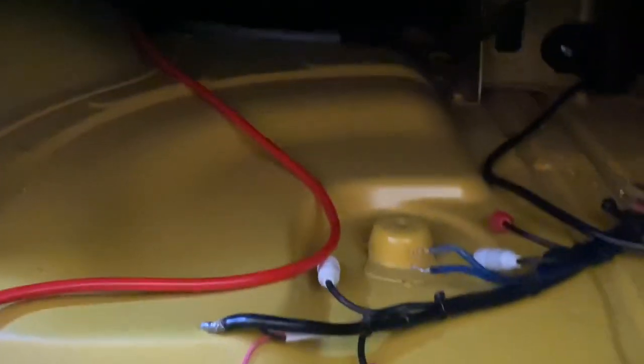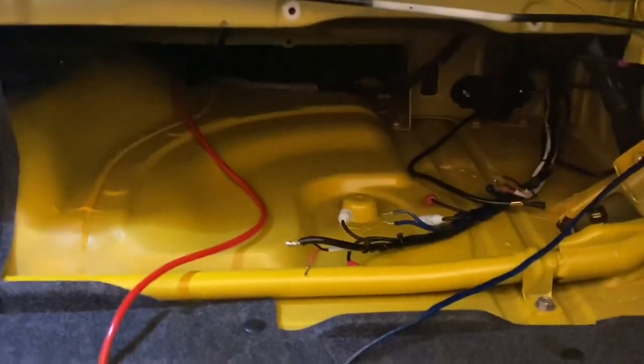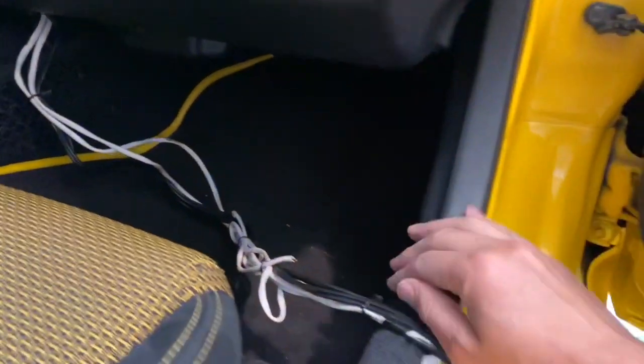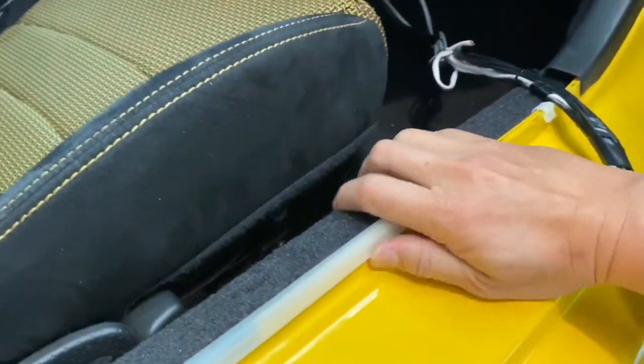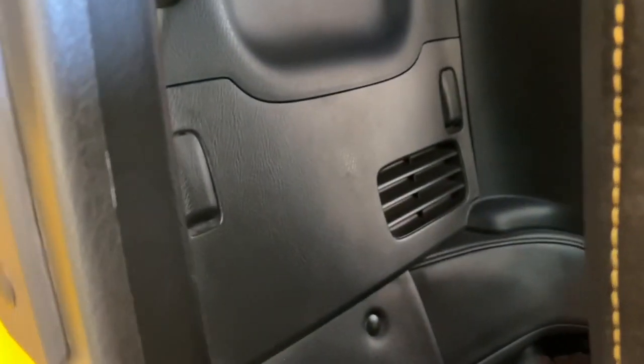Now in the trunk you can see all the wires coming together: the power wire, the black ground wire, the remote turn-on lead — everything is set up ready for the amplifier. The speaker wires are going to be tucked under the carpet, running along the doors and through the footwell, passing under the sill and tucking in beneath the door sill tabs. We removed the factory door sill already, so the wire tucks in neatly all the way across, feeding into the back trim area.